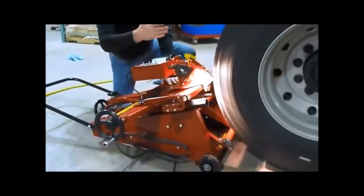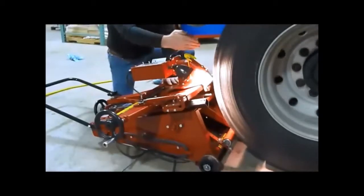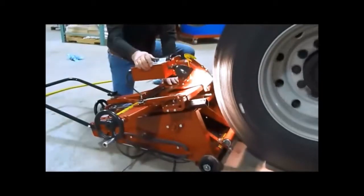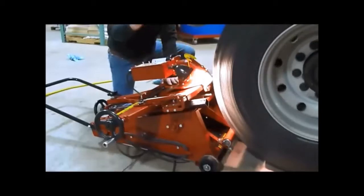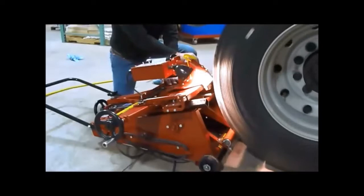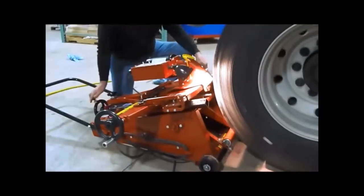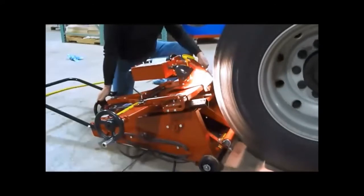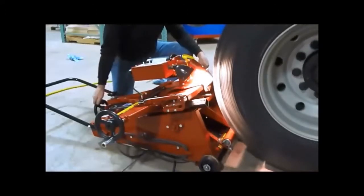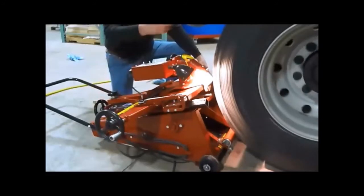Okay? So you get this going, we got our drives, we have our cutter head. We always true from the center out as our rough cut, and then our finish cut coming back to the middle. So in this case, I would be truing to the center, I go to the right on my first pass. So I turn the truer on, I sharpen my blade to a razor's edge, bring the truer up to north, and then just start bringing my cross piece. So there we go.